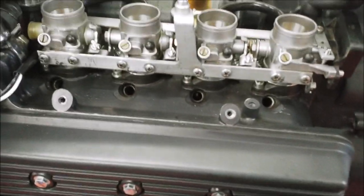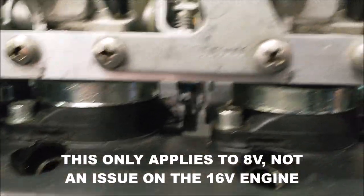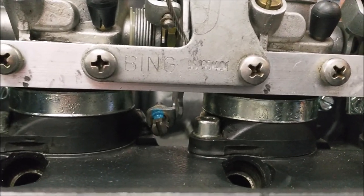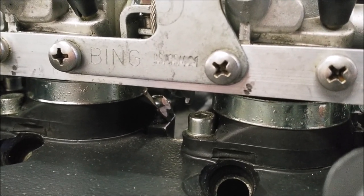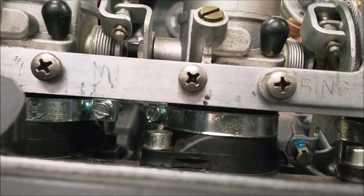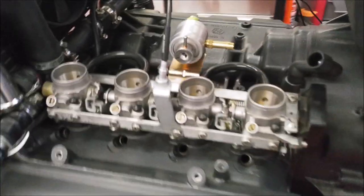The other thing you need to do is, I don't know if you can see this, but where the arm comes through for the throttle cable, just need to cut away a piece of that intake mount there so that that swings by and doesn't catch on it. I just fitted a button-headed Allen bolt on there, so that it clears it, and just filed a little piece away from the mount, and then also make sure that the Jubilee clips are clear for the mechanism that comes around underneath here. Basically just make sure that the cable is free. And that's it for the throttle bodies.